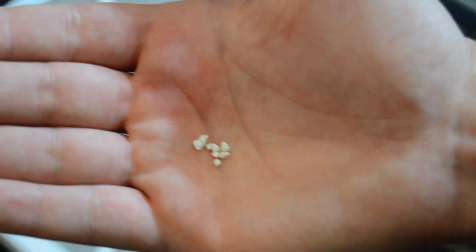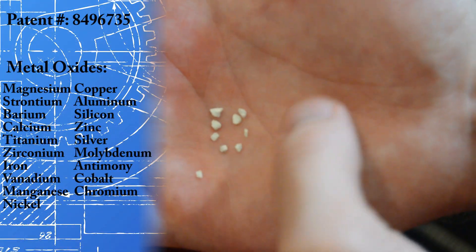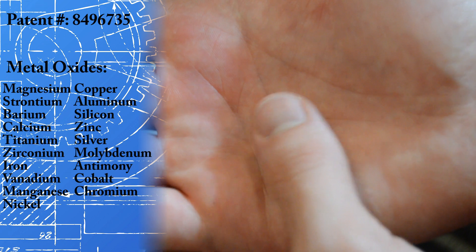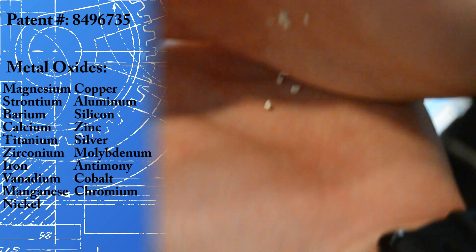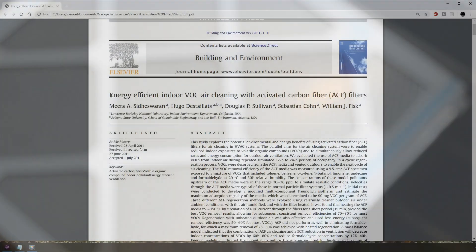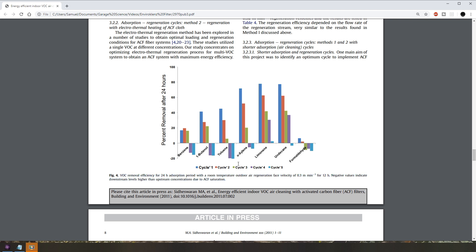The EnviroClean's air filter uses special patented filter media. This media contains a cocktail of metal oxides arranged into a nanocrystalline structure, which ultimately looks like small rocks. I've provided links to the patents in the video description. The metal oxides in this filter chemically react with organic compounds in the air, capturing the compound and thereby removing it. This is different from activated carbon filters because changes in environmental factors like temperature and humidity can cause compounds captured by carbon filters to be released.